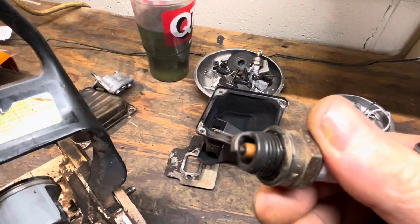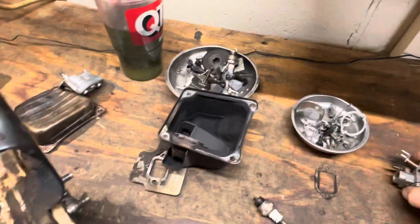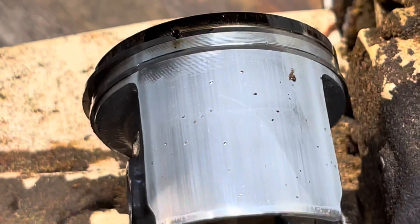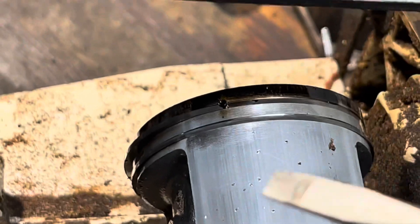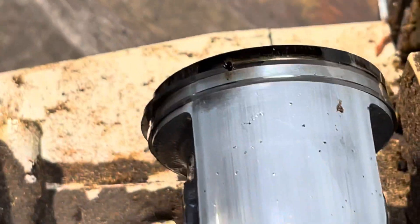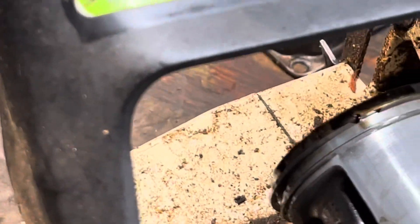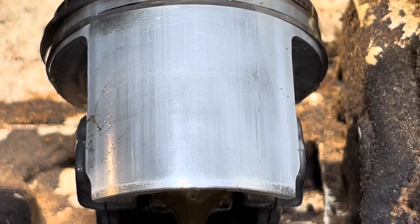Here's the plug that came out of there - looks like that. And if I'm not mistaken, the limiter cap's been removed on this. But let's see if we can get a good view. And if you'll look up here, you'll see where those machining rings were and how little bit of evidence there is. Let me run my thumb across here and kind of clean this up a little bit. Now, those scratches are awful light.